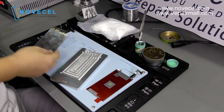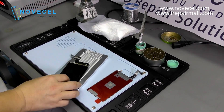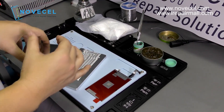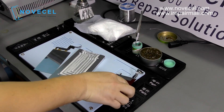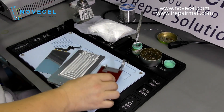So you're going to need a screen. This screen is iPhone 7. Yesterday this one had a touch problem, so we used the bonding machine to put a new flex on it. Now we need to put this backlight — this is for iPhone 7 — and after that we need to wire the flex to this screen.